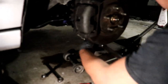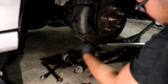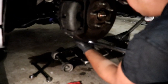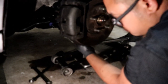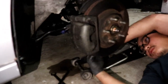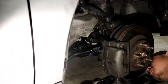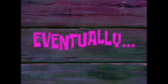The lower ball joint, once it's in the LCA, the bolt that holds it down — per the factory manual — is 46 to 51 foot pounds of torque. There's a range because there's a hole through the threaded part of the ball joint to put the cotter pin through, so as long as you can get the cotter pin through, you'll be fine. Steve's putting in the cotter pin for the lower ball joint, and then we're just going to tighten down the front sway bar end link to the control arm, and this side's good. I'm not going to record the other side because that would be pretty redundant.